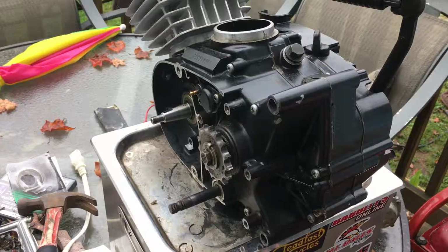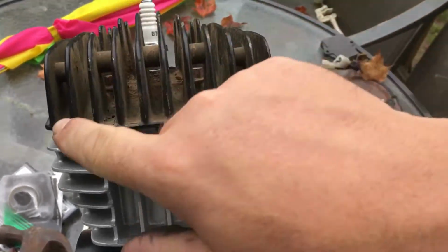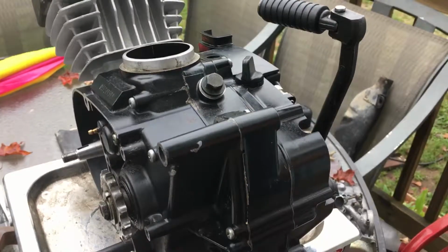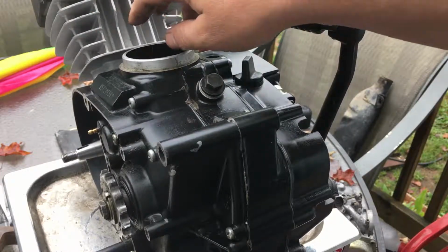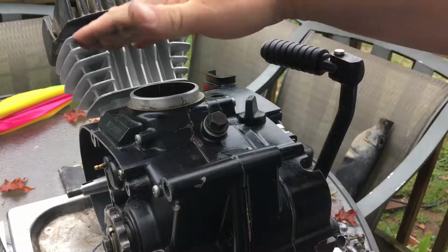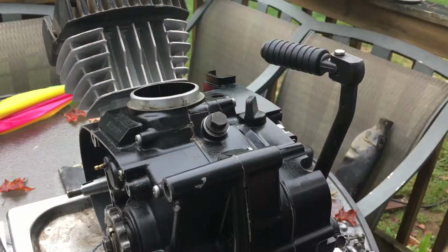Yeah, we got nice head flow. We're not going to put no holes in the bottom. We got beautiful head flow. So we're good there. We're good. So we got coolant fins going up the back of the cylinder right here, which is kind of kind of stupid. They should have had them going straight across so the air can circulate that way, but they didn't. So I'm not going to worry about it too much. Just keep an eye on it and see how the temperature goes.